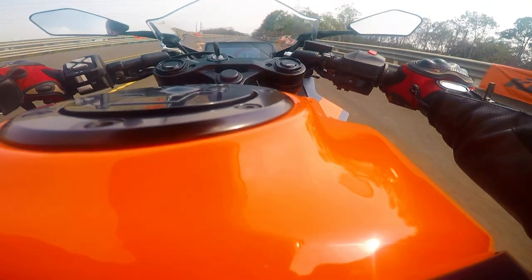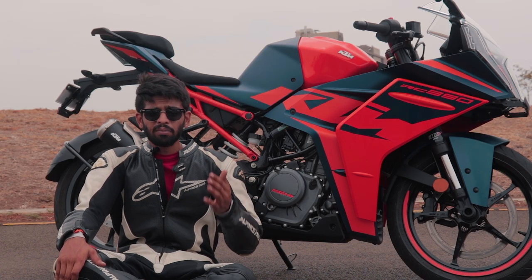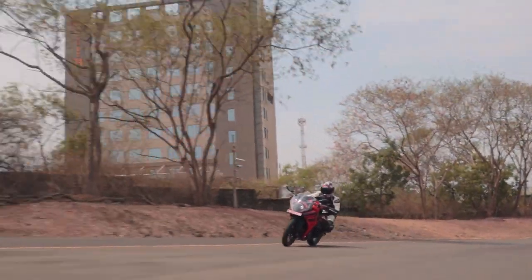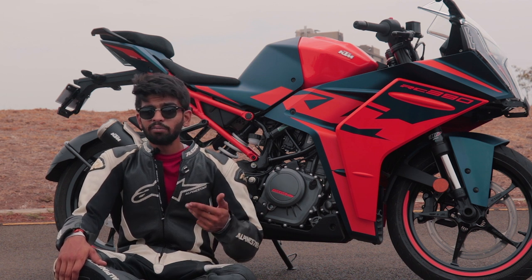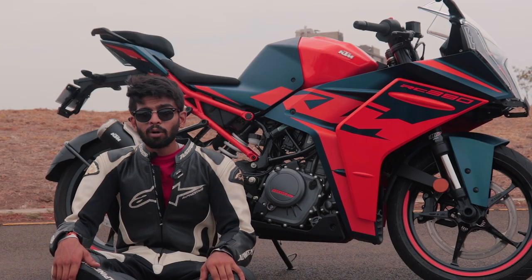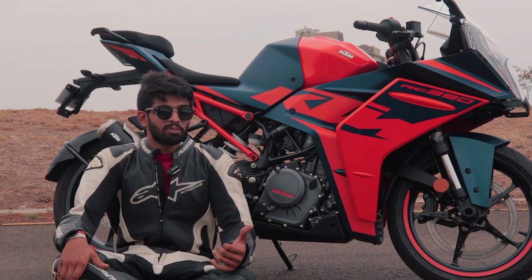Because of the 40% bigger airbox, the banking corner you'd normally take in fourth gear — over here at fifth gear, over 110-120 km/h, I'm able to carry the speeds into the corner and into the VMAX. The response is just amazing. A few people might say it's lost the top end, but on a track, average pace matters more than top end, and that's where KTM has hit the nail on the head. The suspension is perfect, engine response is great, the clutch is light, the gearbox is slick, and the quickshifter does its job post-6,000 RPM. The Metzeler tires have sufficient grip — ample for anyone up to a novice or rookie rider. If you go very hard, you'll want better rubber, but that applies only to the top 2%.